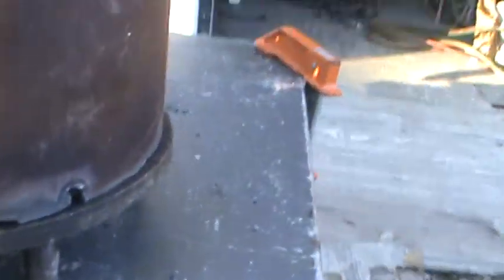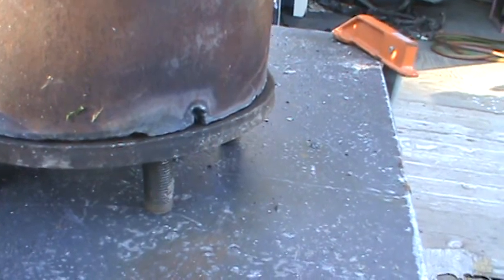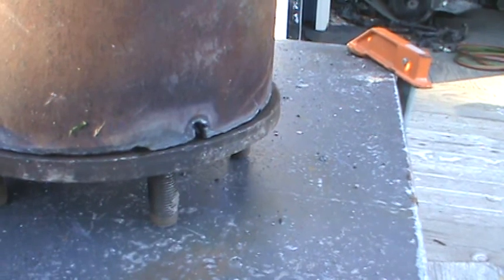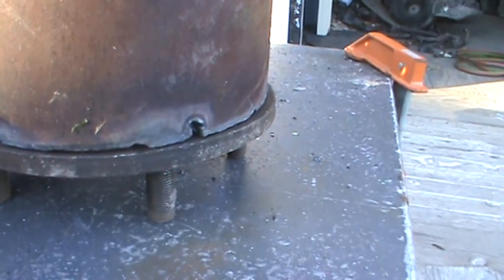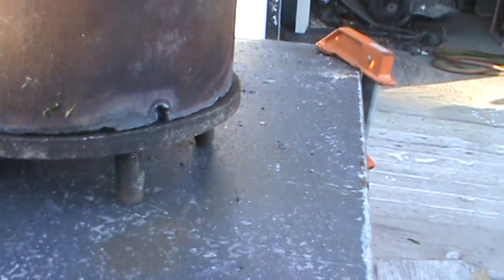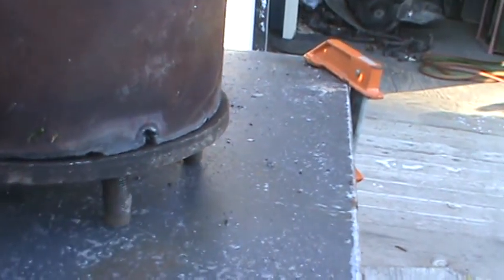I was told to set it to where it touches. I would suggest not doing that, and I would leave a gap. Someone told me 5/16, which makes really good sense, because the first side I just butted it up, and let me tell you, it's kind of a pain in the ass to bolt your axle in with this when this is already welded onto the axle.